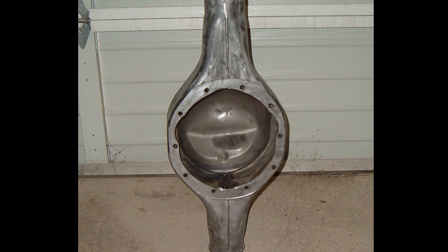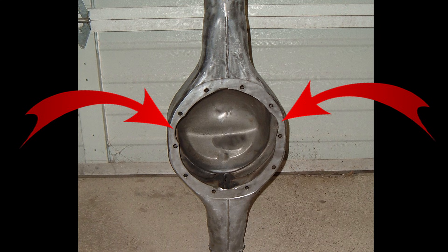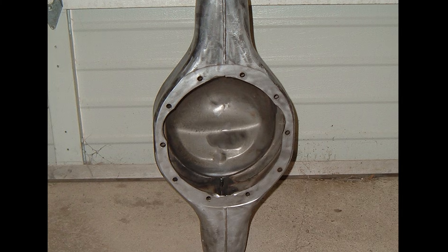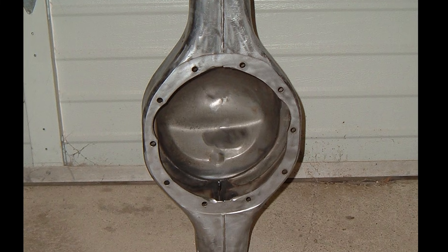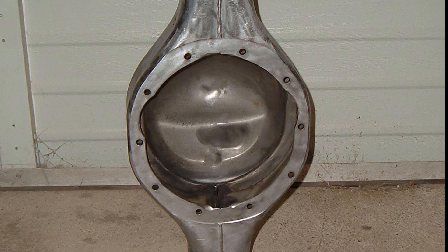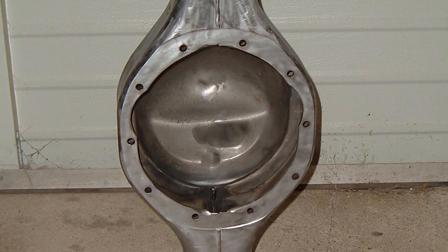The donor housing for my Ford 9-inch was actually a Ford 9-3/8-inch rear-end. The good news is the carrier and bolt pattern is the same, and all that had to be done was the housing had to be slightly notched to accommodate the slightly larger ring gear. I took this one out of a 69 Country Squire — a perfect donor because the center section was no good, but the housing itself was extremely strong. It also turned out well that the ID on the original axle tubes just happened to be the same as the OD on my 8-inch rear-end axle tubes, making the whole process fairly simple and straightforward.